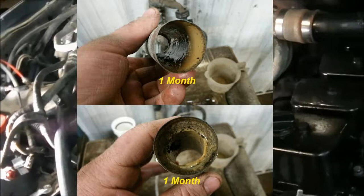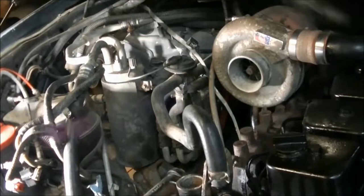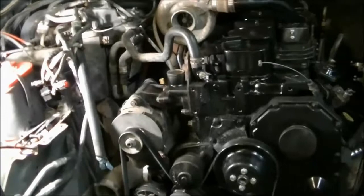And then I put the screen in, and the screen plugged up within like an hour. Had half a cup of junk in it. And then we ran it for about a month and had another half a cup of junk in it. So it does take quite a bit of stuff out of the system that gets missed, no matter how good you think you flush it. And some of these heater cores are not very fun whatsoever to change, so